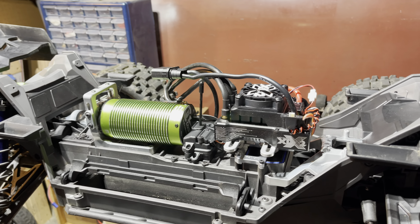The other day when I ran it with this gearing, the ESC was only drawing 250 amps, so I know it's got a lot more in it. I can gear it up if I want, but with this gearing it's already wild. If I gear it up more, I have a feeling I might end up breaking drive shafts or drive cups because this motor has a lot of torque. I'm gonna run it like this for a bit — this gearing should give me around 60 miles an hour. I haven't checked it; I need to get a GPS to check it, but it should be close to 60 if not more.